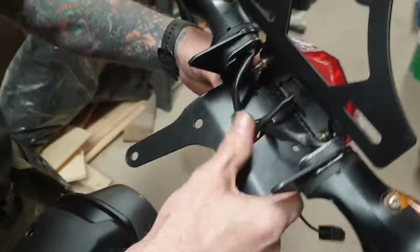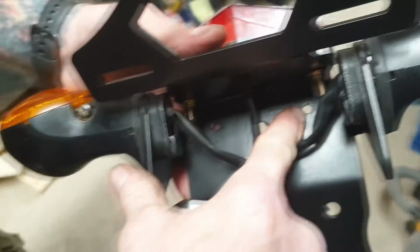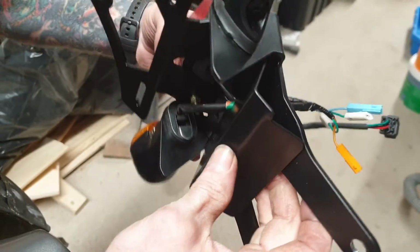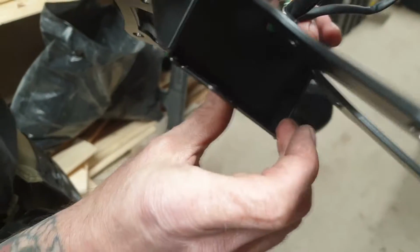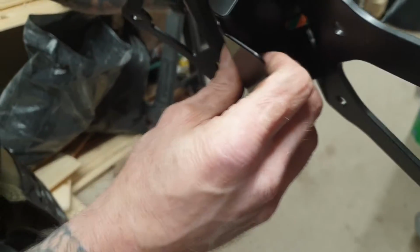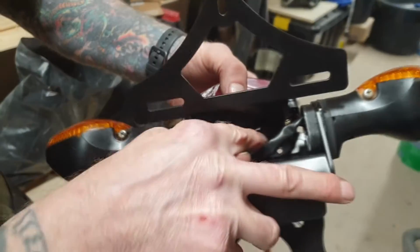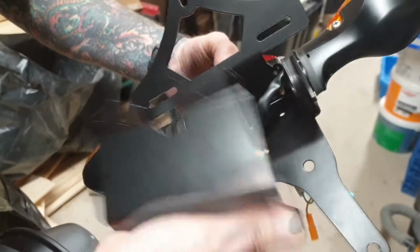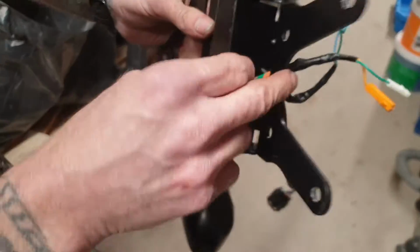Like so. And I'll just grab the bracket system. Here's a little bracket, and what you'll see there is there's two holes there. They align up with that, and then like so. And then when you put this onto the actual bike, that fills the void underneath and makes it look all flush and as factory as such. So what I'll do now is I'll just loosely fit those so we can hook it on the underside of the existing undertray, and I'll show you how that goes. There you go, I've used the M5 hardware supplied.